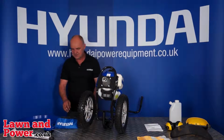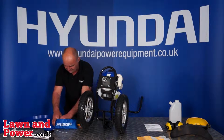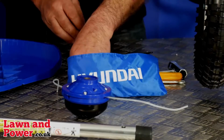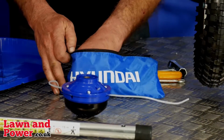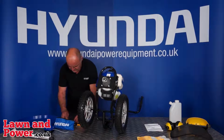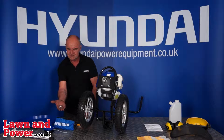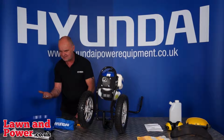Okay, if you go back to your toolkit again, you'll see there's all sorts of tools in here. What we're looking for is the small Allen bolts. Quite a few Allen bolts in here. I'll describe which ones are which and where they go now. There we are. First of all, you'll find that you've got 3 Allen bolts all the same length. Now these are the 3, there are only 3 that are all the same. These are the 3 we use for fitting the guard to the strimmer head.